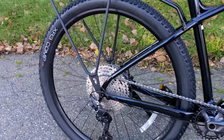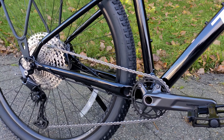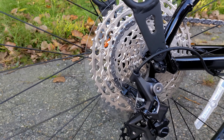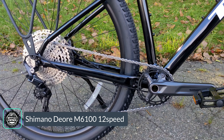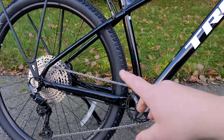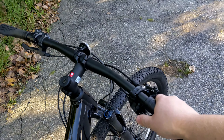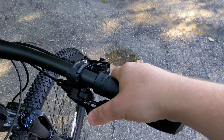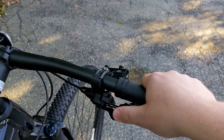From a drivetrain perspective, it's got an impressive setup here. This is a 12-speed drivetrain from Shimano. The 12-speed is really nice because it's got a super wide-range cassette — a 10-to-51-tooth cassette, which gives a 510% gear range. That should allow this bike to climb, descend, and basically do everything with only one shifter. That's going to help keep the officer or first responder able to maneuver their bike without getting held up trying to shift around. You have the trigger shifter via the Shimano Deore shifter on the handlebar.